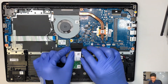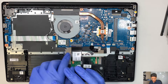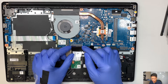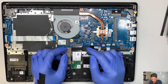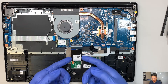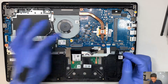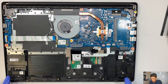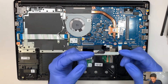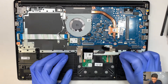Let's take a look at the connectors. This is your keyboard connector — to remove the keyboard, slide the two securing clips down towards your body to loosen them, then slide the flex cable down towards your body. Right here are more likely your speakers — the speaker is on your left and right. Use two fingernails and slide the speaker connector down towards your body. Then open up the clip and slide the cable down. This connector is for your touchpad.